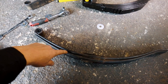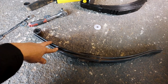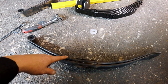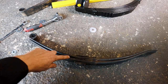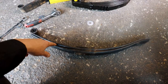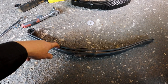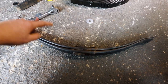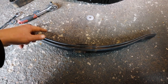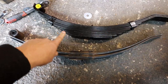When I bought my suspension, I asked for around about a 1.8-ton suspension load on the springs because I thought the trailer would be around 1,600 kilos. The lady said these were two-ton springs, so I installed them thinking it was a bit of overkill but should work. I saw there was hardly any suspension travel in them, so I phoned today and spoke to a technical guy — this set is actually made for two-and-a-half-ton suspension. When I ordered a two-and-a-half-ton axle, they assumed it was going to carry two and a half tons and gave me matching springs.